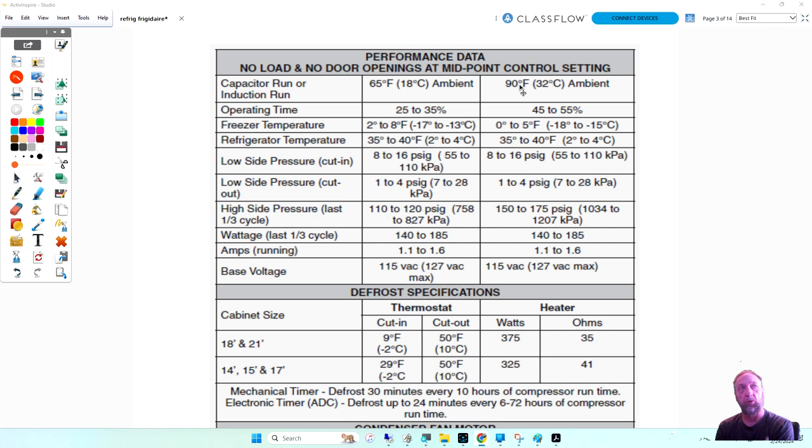I had something very similar happen to an ice machine I'm working on. I'm going to try to put a video together for that, and I have to finish the fryer. The ice machine that I'm working on at school is a big commercial machine, and it has a water-cooled condenser. It means water flows over the condenser instead of a fan. Well, there's a valve that controls that water, and the valve got corroded inside where it wasn't closing.